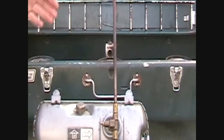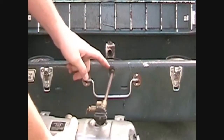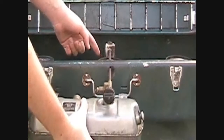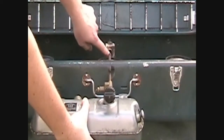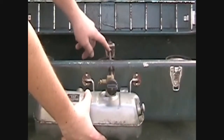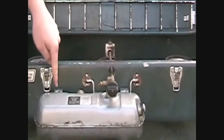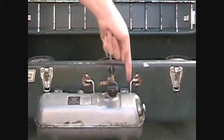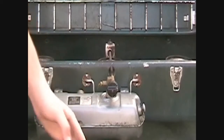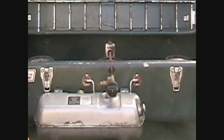To place the gas tank in the stove, you must take the pipe of the gas tank and first place it through the hole in the front of the stove. Then you must take the pipe over to the other end where there's another hole where the gas from the gas tank goes into the stove, and you must place the pipe there. Make sure as well to place the two tabs of the gas tank into their respective holes in the stove. Make sure that when you place the gas tank, it is not hanging over the edge of the table, but has a section of table underneath it.